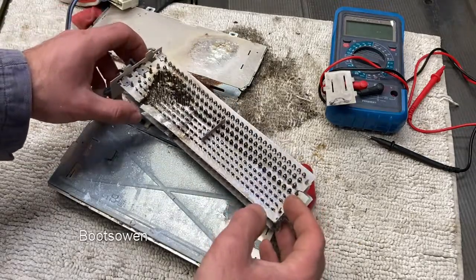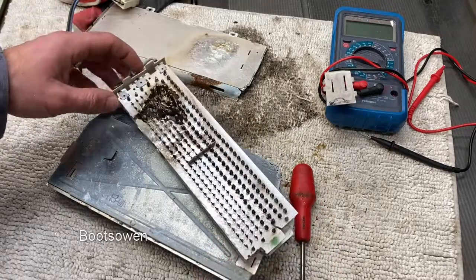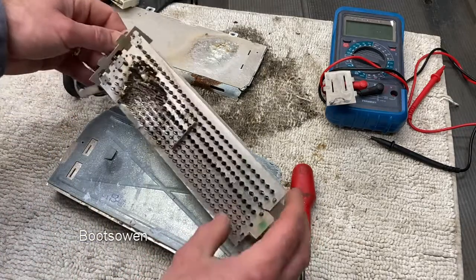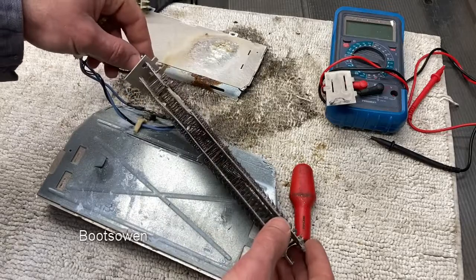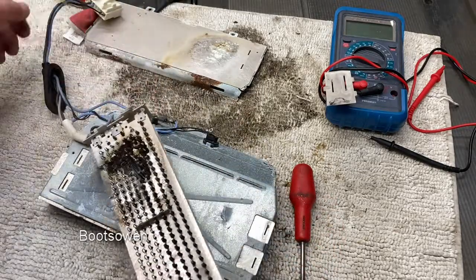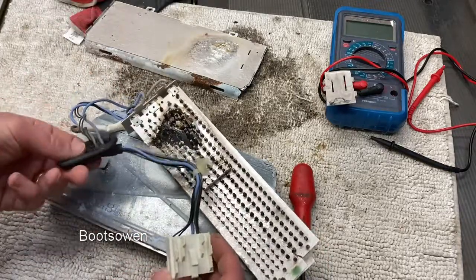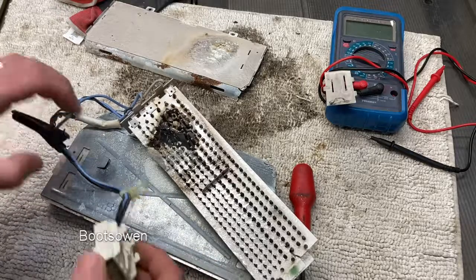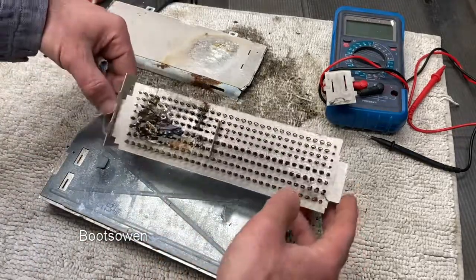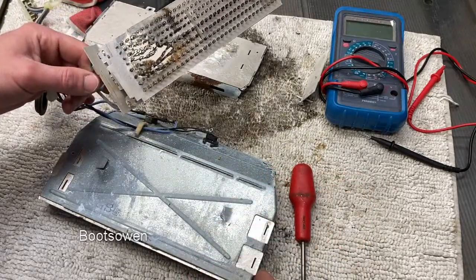And at the moment, I dry my laundry with a gas tumble dryer, and I also have just recently acquired a heat pump tumble dryer that seems to work. So I don't know what to do there. I think that one's kaput. I think I'll take the sensor off it. The reason it's expensive, I think, is because it's a whole unit with a plug and a rubber grommet and all that stuff. If you could just get this internal element, which is really all you want, but because the way those things are staked over, they don't tend to sell them separately.